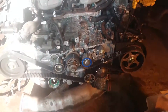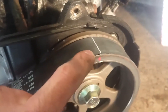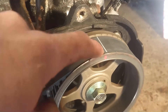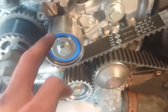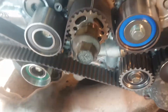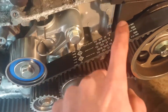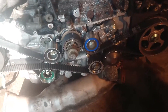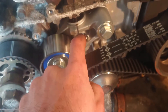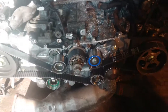It's going to be money well spent, so I'm glad I just got the new kit anyway. The new timing belt is on with all the timing marks lined up. I put it a tooth either side to confirm - a tooth to the left put the timing mark way out, so I'm confident it's in the correct position. New tensioner and all new pulleys are on. I feel much better about this belt - it's got part numbers and a direction arrow. I pulled the pin on the tensioner. New timing belt kit installed - I've left the old Japanese water pump on.